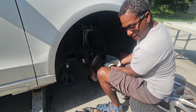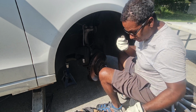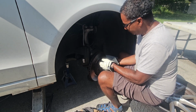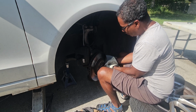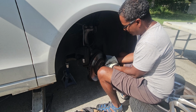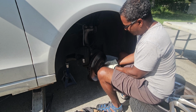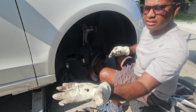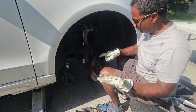That broke off. That broke loose really easy. I like that, because a lot of times brake components, they're in there, you know, they're committed. So the fact that this one, even with a small 1/4 inch ratchet, just popped loose really easy. And there it is, just a little T30 screw that goes into here and holds the rotor.